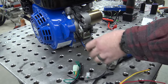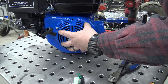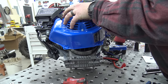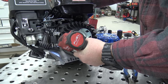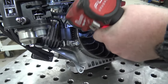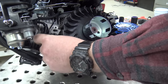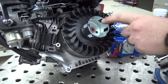We need to pull the four 8mm bolts out of this side cover to pull it off, and then we can remove the flywheel. The next thing we're going to do is remove the ignition coil — it's going to be easier to get the flywheel off with it removed. Use a socket to pull that off and just set it aside. It just doesn't allow — it can get caught on the flywheel when you're removing it.